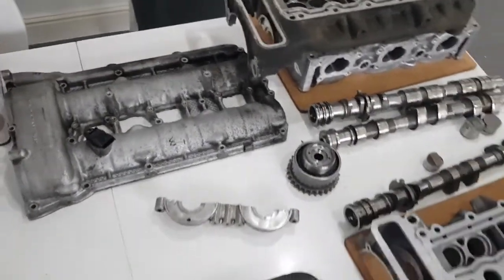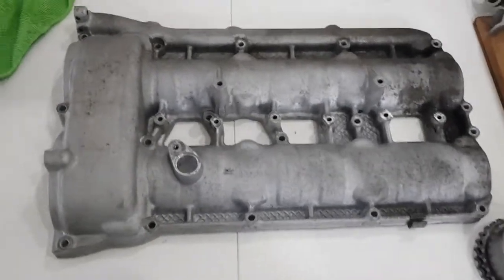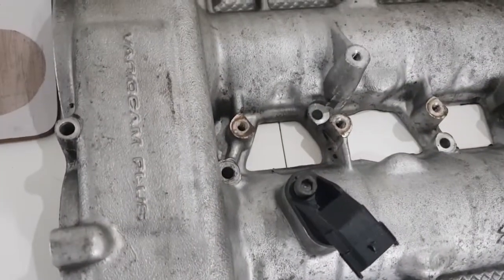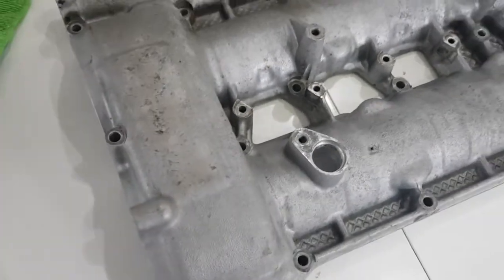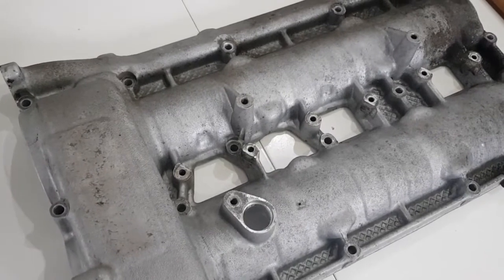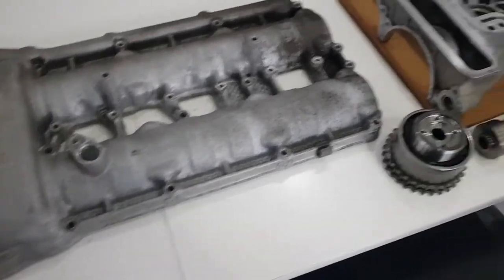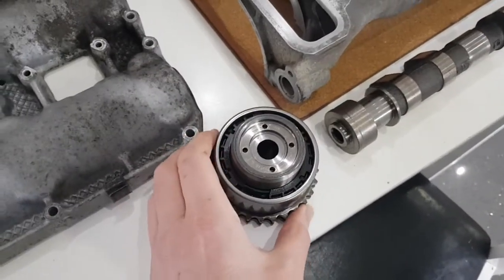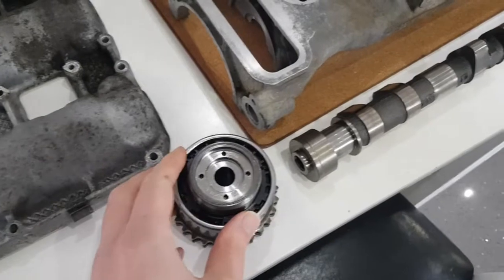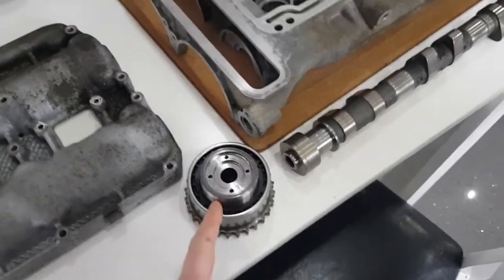In terms of the castings and parts, they're based on the same castings. The difference on the turbo one is you can see it says VarioCam Plus on there, whereas on the GT3 one that's basically machined off — it doesn't have VarioCam Plus. VarioCam Plus is the combination of switchable timing on the intake in terms of switching the cam lobes, but also being able to vary the timing. This is the actuator unit used for varying the timing; it goes onto the inlet camshaft and adjusts it.